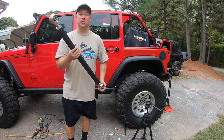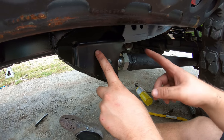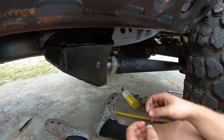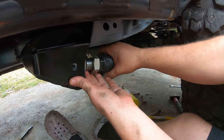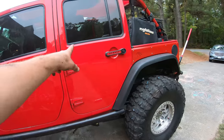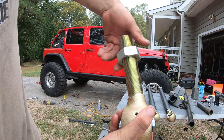It's time to install our new link. The offset Enduro joint is going to be on the axle side. Make sure you get it in both brackets — put this end in this bracket and that end in that bracket, then adjust it. Since the brackets are boxed closed on the bottom, you can't slide it up in — so shorten it, put it in the brackets, and expand it. Since it's double-adjustable, just twist it to make adjustments. While we're at ride height, align the hole and tighten the nut. Do the same steps on the passenger side.